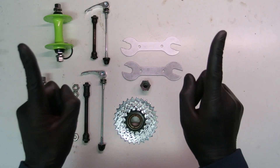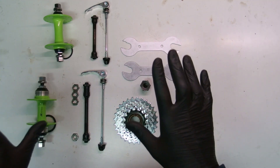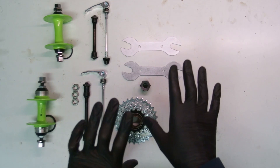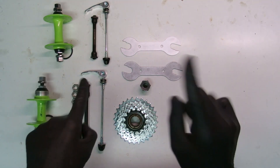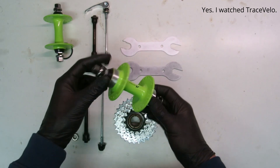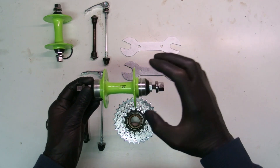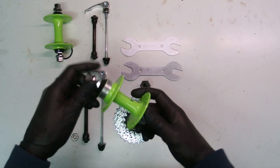One important thing: I have already done all of this before — I'm doing this just for the sake of presentation, which means the disassembling of the hub is going to be much easier than before. Assembling and disassembling cup and cone hubs is another topic and I've already covered this on this channel. Also, word of warning: if you're buying a new cup and cone hub, which this obviously is, they routinely come from the factory way too tight, which destroys the bearings. It is well recommended to adjust them out of the box and make sure they are spinning freely without any drag.